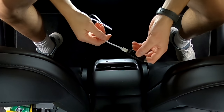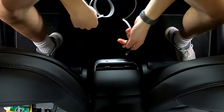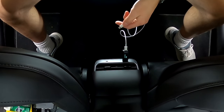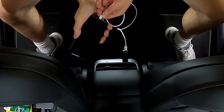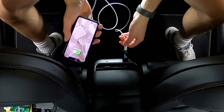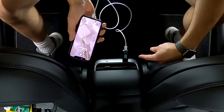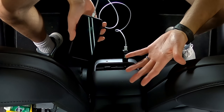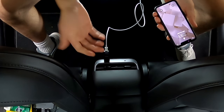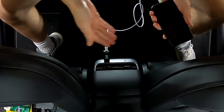So we've got the two USB-C ports back here. I have the USB-C reader along with a lightning cable, and we're going to test first what the phone does being plugged in. Looks like five volts. We're going to plug this in and we're getting five volts, going up to nine, ten, thirteen. So these are fast chargers back here — 13, 12 watts. You could probably plug in a laptop and keep it going. This is at 59% on my phone, probably would be a little different with a different phone. Let's try the other port — it's pretty much the same.